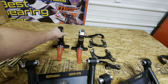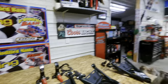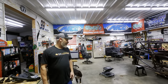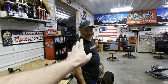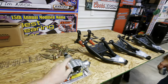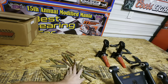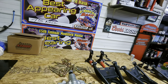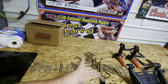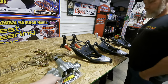We've got some three-piece spindles from AFCO — they're actually a Speedway spindle but bought straight from AFCO. Steve over at Final Finish did a nice job powder coating them. There's basically nothing on this car that won't be painted — only the center link and idler arm are exceptions. We also have a KSE six-to-one high-speed steering box, and we made a trip to Tractor Supply to buy bolts by the pound, which is way cheaper than a big box store.